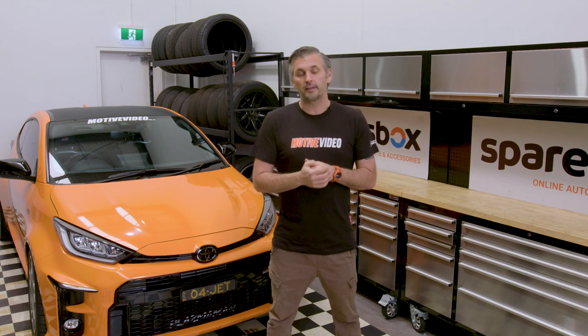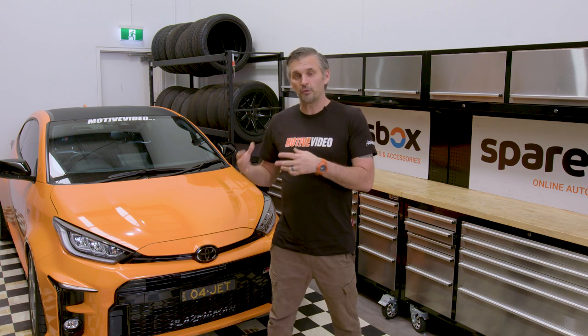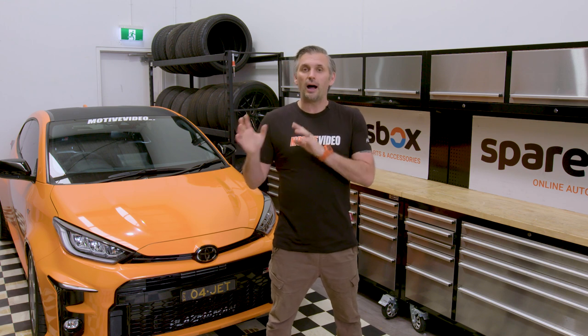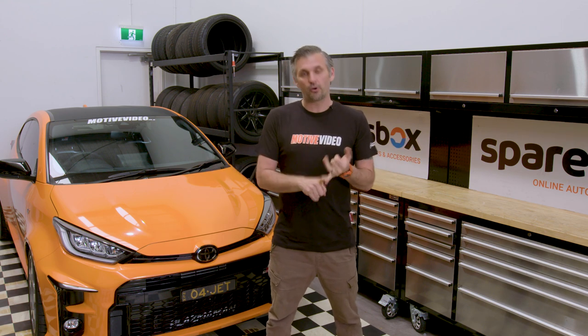And it's been fantastic. Now, I'd love to give you some driving impressions, but with the car set on wastegate pressure, obviously it opens a bit slowly. And we haven't tuned the car to specifically suit this exhaust manifold or add timing based on any restriction that we now no longer have in the rear housing, etc. So we're going to save the driving impressions till after Power Tune have installed the larger injectors and tuned the car.